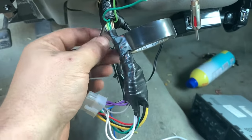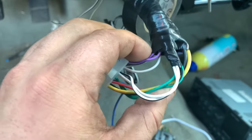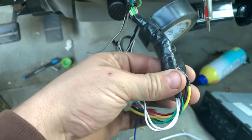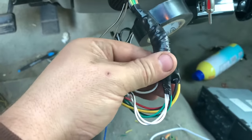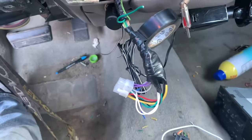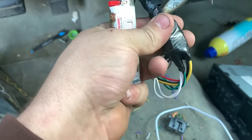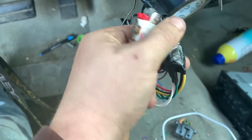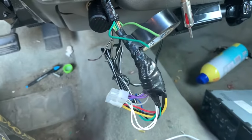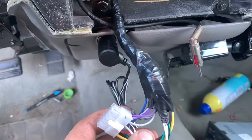Usually I tape the loom all the way up to the connector clip, but because it's bent and bulky I don't want too much stress on everything, so I'm only taping up to here — that'll make sure no wires move. I heat it up with the lighter and just press it — it helps the adhesive really stick. I'm going to finish taping the straggler wires and show you what it looks like, then plug it in and put everything back together.